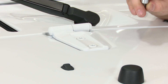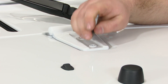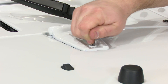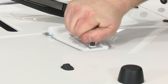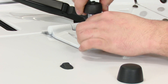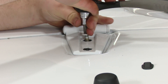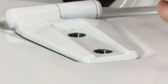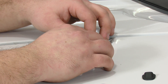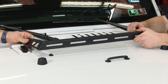With the mount assembled, remove the four T47 Torx bolts securing the hood to the hinge. Getting the Torx bit in there might take a little bit of persuasion because they are painted over, and it's not that easy to get in there, but with a little bit of wiggling and persuasion it will go in. Grab the provided gaskets and install one on each hinge. Install the bracket, and be very careful not to scratch your paint.